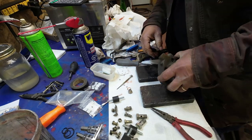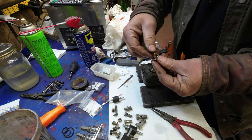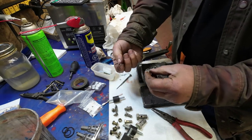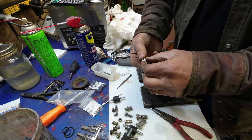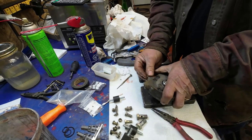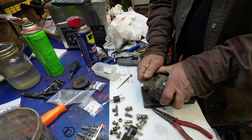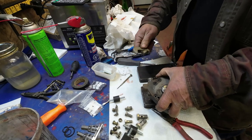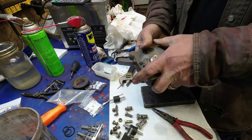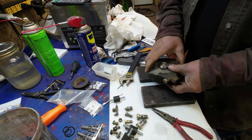And then, oops, it's got a new copper washer for that, right there. And it's got two new shims, right? I'm just going to put them in there so I don't lose them, and then we'll adjust the fuel pressure later on the car. It might need more shims, it might need less shims. I've got my handmade shims here that worked all right also. Got a metric adjustable, right? That's back together. Now we'll just hope that it all works okay.